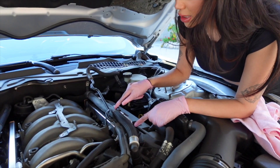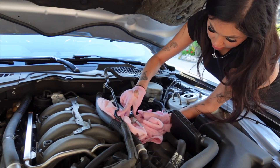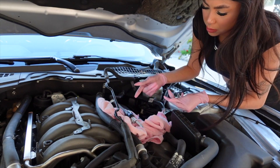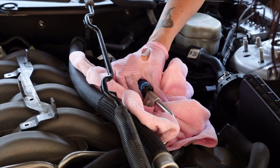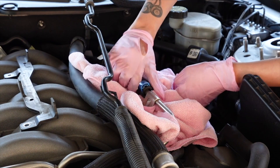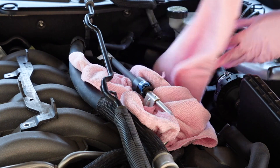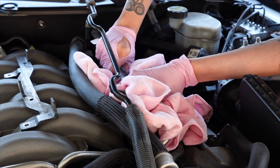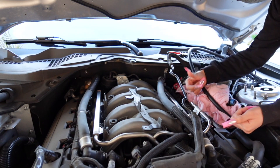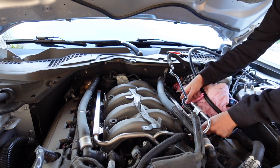Right here is going to be my fuel line. It should pop up like that. Once you've pushed these together and it releases, you're able to push back the fuel line. Now that I've removed the foam, I have access to disconnecting the fuel injectors.